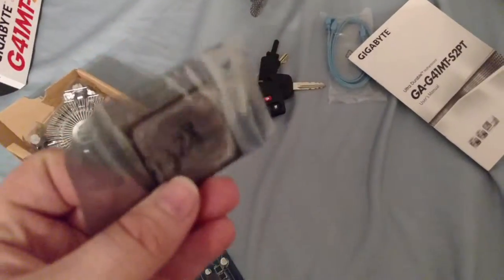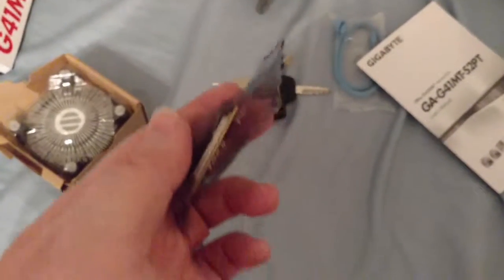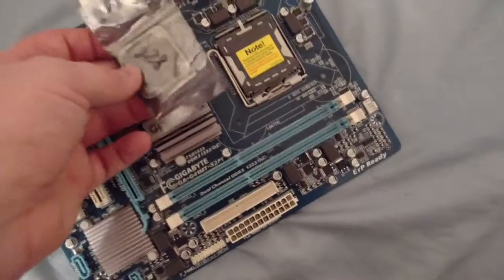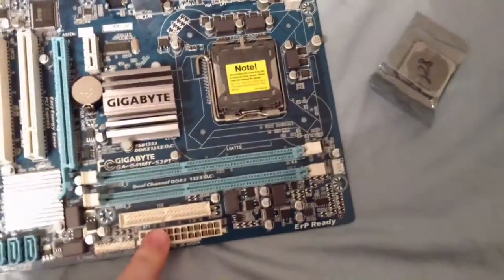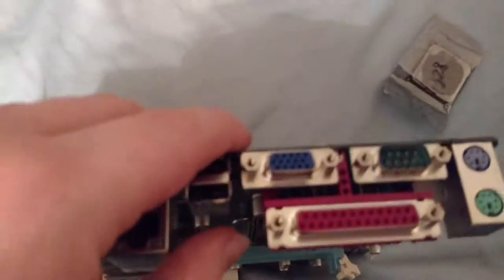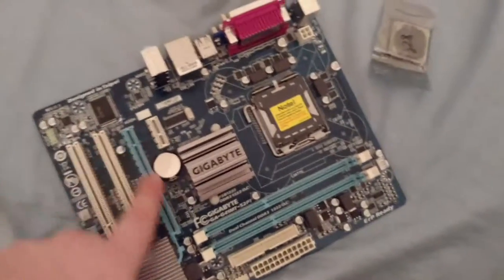The processor is in a plastic bag to keep it safe. It should be an E6600 or E8600 Core 2 Duo - this was an enthusiast chip back in the day. To install it, you line up the triangles on the chip and the motherboard, drop it in, attach a cooler like this one, press it down, and plug the fan in. Since this board has onboard VGA that's enough to get it running, but VGA is low resolution and won't handle a 1080p TV well, which is why the PCIe graphics card slot is important.